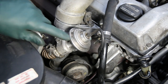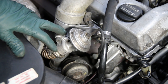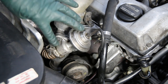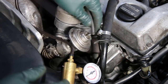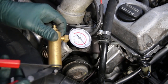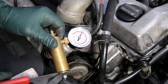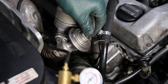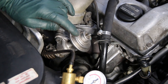This is the location of the EGR valve on the later diesels — the OM602 and OM603 engines built in the mid to late 1980s and early 1990s. It's located in about the same position as the OM617, a little different design. I hook up my vacuum hand pump tester, make sure I have a good tight connection, and start pumping. I bring it up to 10 — no evidence of leak-down — up to 15, 16, no problems, then right up to 20 and the needle is holding steady. That means the EGR valve is not leaking. Pulling the hose off quickly, we hear a good strong snapping sound, which means the valve had been opened and then closed and seated.